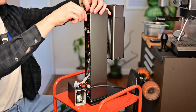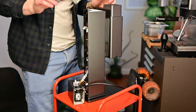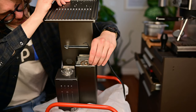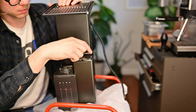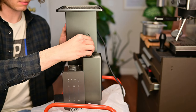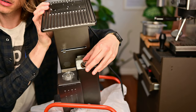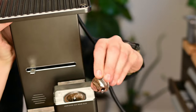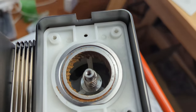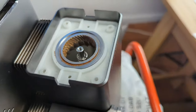I then removed two screws near the top, and the top panel came off very easily, but there's really nothing interesting up here other than some insulation. That top panel does come out pretty elegantly though, with two plastic hooks that hold it in place. Now for the grinder — there are four screws holding this steel cover in place, and these look like they were designed to thread into plastic. With the screws out, I could pry the cover away. Removing the inner burr was easy enough with an Allen key, and I could take a closer look at that grinds distributor. The burr is sprung, so it easily pops right out. These are pretty high quality conical burrs that people seem to be happy with, and the team went out of their way to make them long lasting with a special coating. Here's a closer view of the outer burr and the inner burr carrier, which appears to be stiff enough to avoid burr wobble and any resulting grind size inconsistencies.